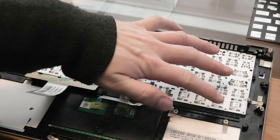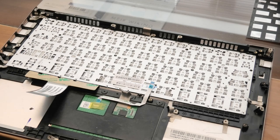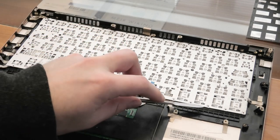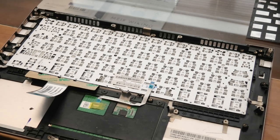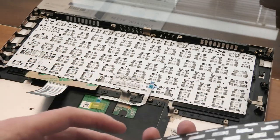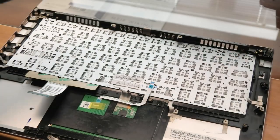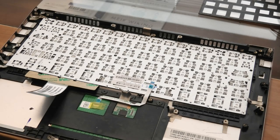Surprisingly it wasn't too hard to get all of this melted plastic off. I got help from a razor blade — some I cut off, others I was able to break apart with a tiny tool, and I managed to do that without making any damage. Then we have this thing that goes on the back — I think it's the backlight for the keyboard. I'm not too worried if that doesn't work, but I'll put it back with some tape. This UX32V is not very serviceable.